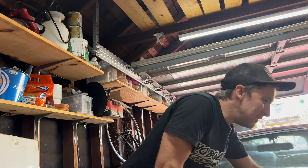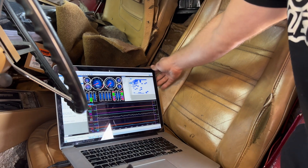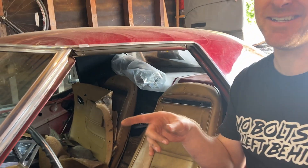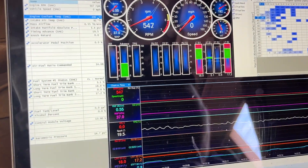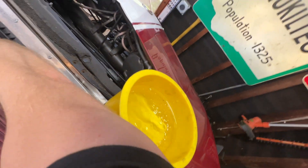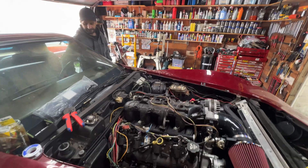There is a little bit of a whistle — is it from the intake? I don't know. Got no fans yet, but I don't think the thermostat's open yet either. Engine coolant temperature — what are we at? 189. Okay, we're close, it might open up soon. It'll probably be around 200 or 210. This thing did not have power fans when it was in the Tahoe or the Yukon — it was a mechanical fan. So I'll probably have to set that, and I definitely will not let this get over 210. I just kind of want to see that thermostat open. We're at 192. We're getting some air pockets — there's a little bit of water in there. I'm thinking it's opening right now. Upper radiator hose is hot, so I guess we can call that good.